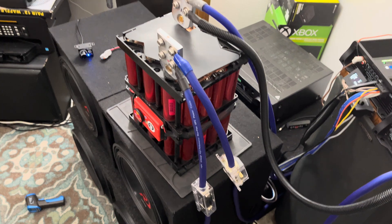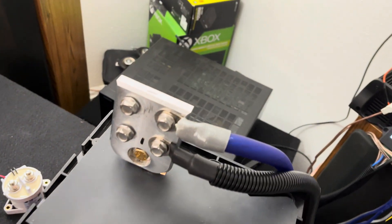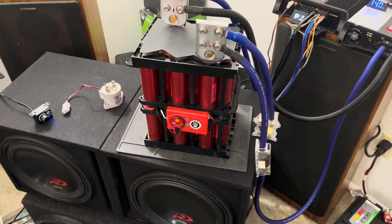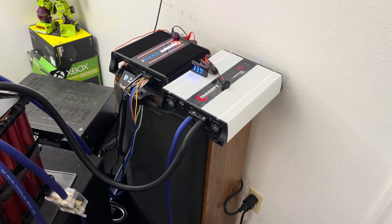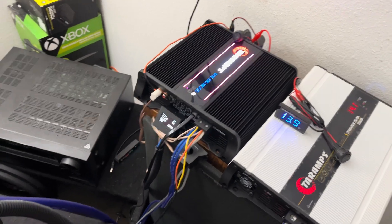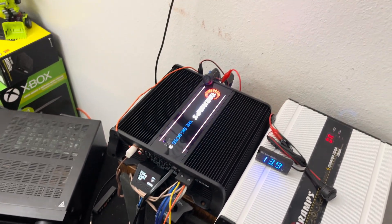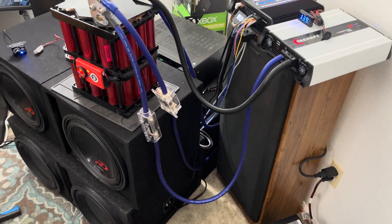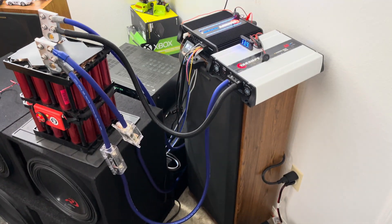Either my fuse blocks are failing me, or this wire is just not good enough. Maybe the wire lugs aren't good enough — I don't know, that freaks me out. I'm super stoked about the — what is it called — the Super Beast or something. I got the Headway lithium kit now. I don't know what to make of this. This is why I want to do all these tests, because stuff just doesn't quite add up. Maybe my equipment's all damaged, maybe at some point I let them clip and they broke, maybe something's not measuring correctly, maybe I'm doing something wrong. My only thought is I feel like this wire is just not good enough. I still feel like I should be able to do more than 1700 watts on zero gauge OFC.